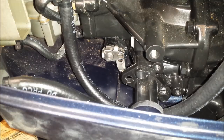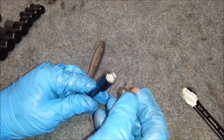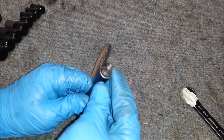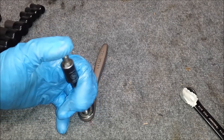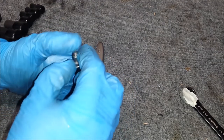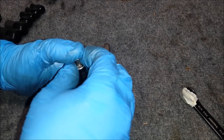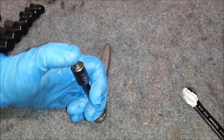Anyway, I'm going to tighten down the lower, get that nut back in, and fill up the fluid. What I'm doing to help get this pin in is cramming a bunch of masking tape inside of my socket so the screw rests right on the outside and doesn't sink inside of my socket. The screw almost fits in it, so that should help a little.